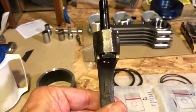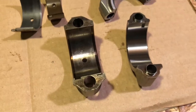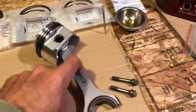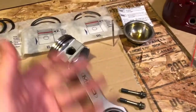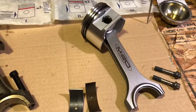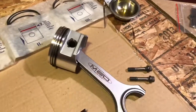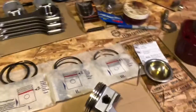See how that connecting rod is sideways to the center line of the piston — that's what we're talking about here. So here's what you get: thinner bearings, smaller bearing caps, narrower. I showed on a previous build that these components from MED — piston and rod assemblies, crankshafts — are almost half the weight of the factory pieces. About 40% lighter on average.